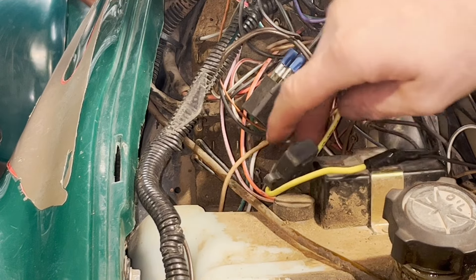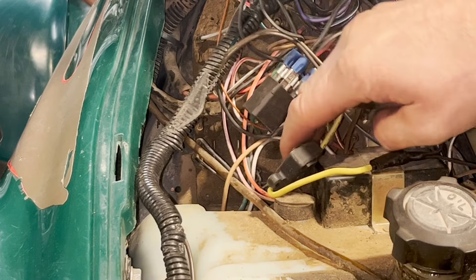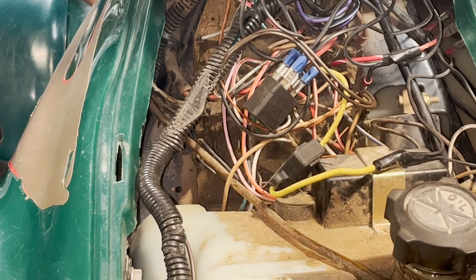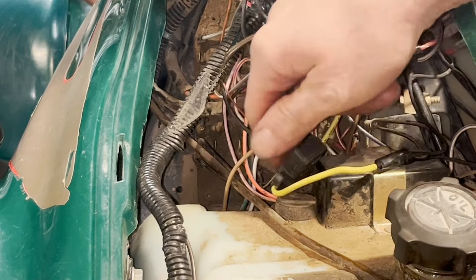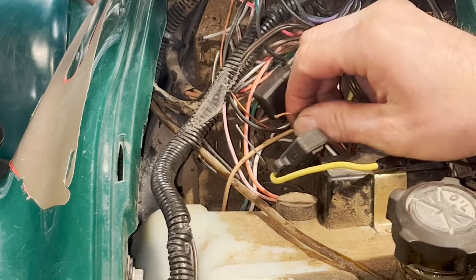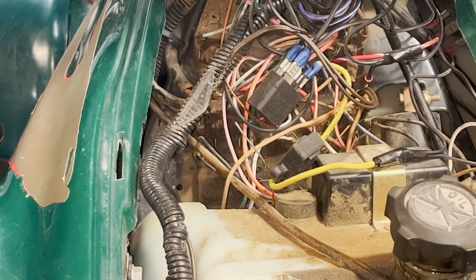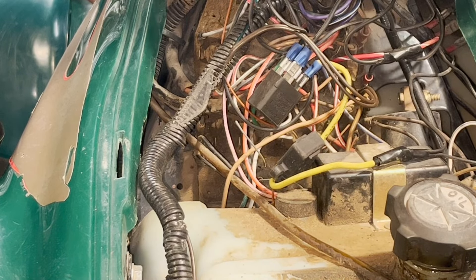As I was looking for a couple of broken wires hanging out, nothing jumped out at me at first. So I followed up the other wheel's wires and found where they hooked up, and then sure enough, right by it, there was a broken gray wire and a broken orangish-red wire. So we'll hook those bad boys up. To test that and make sure they're getting power there — we don't have to start it, just checking what we got.